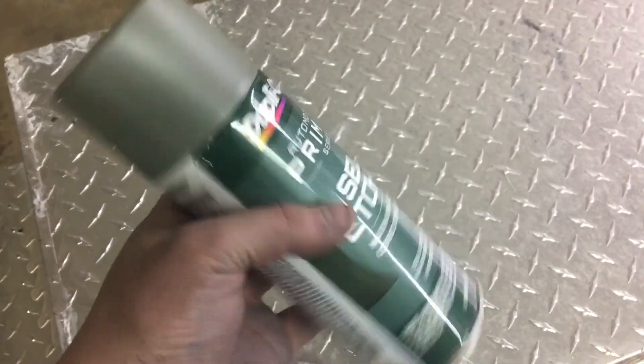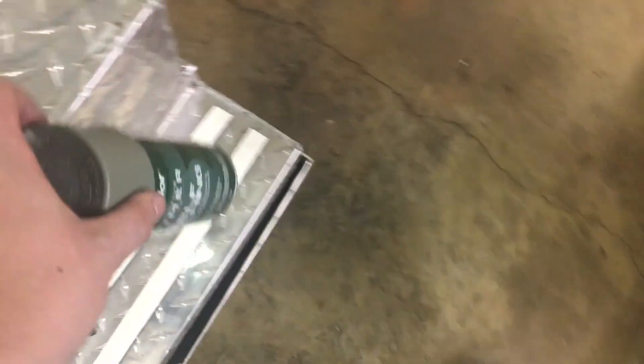After I've washed it with denatured alcohol one more time after sanding, I'm going to spray down this self-etching primer. I'm going to do the bottom of the bed rails and this piece in just regular old spray paint — I'm not really worried about it staying on that well because it'll be on the bottom and you won't be able to see it easily. The self-etching primer should help the paint adhere without having to sand it. I'm also going to paint the inside, so I covered up the stickers with the toolbox information and covered the peg holes on both sides.